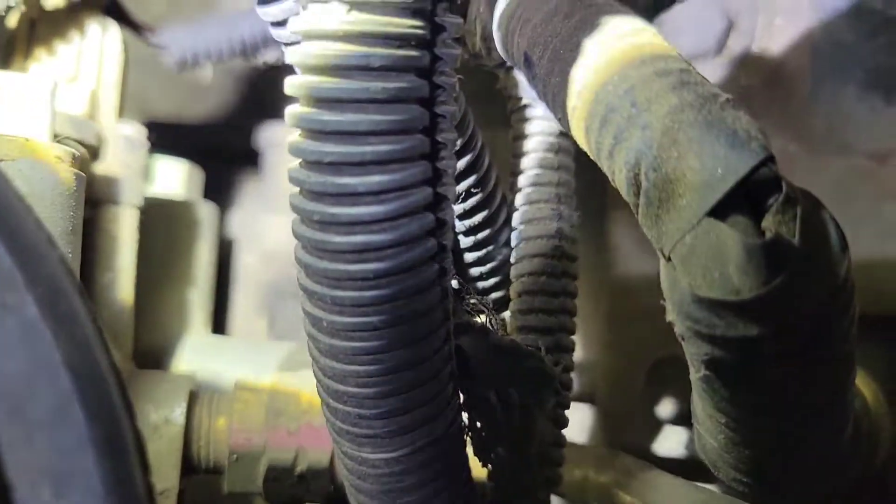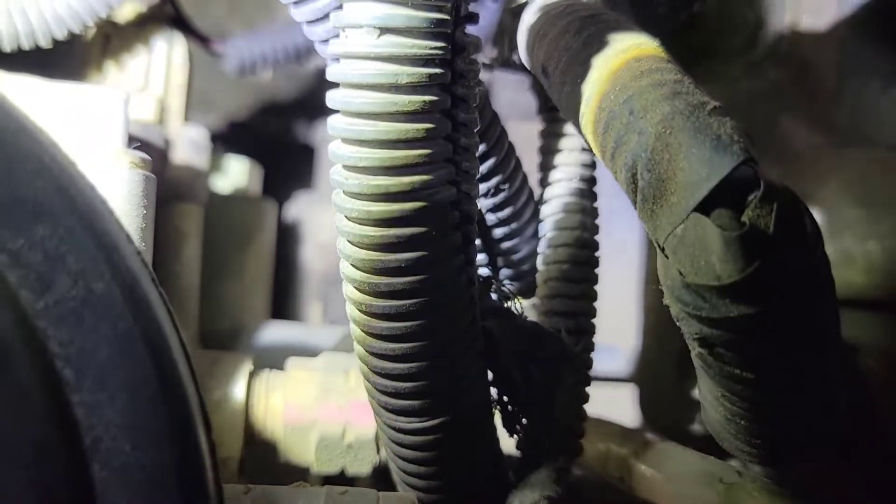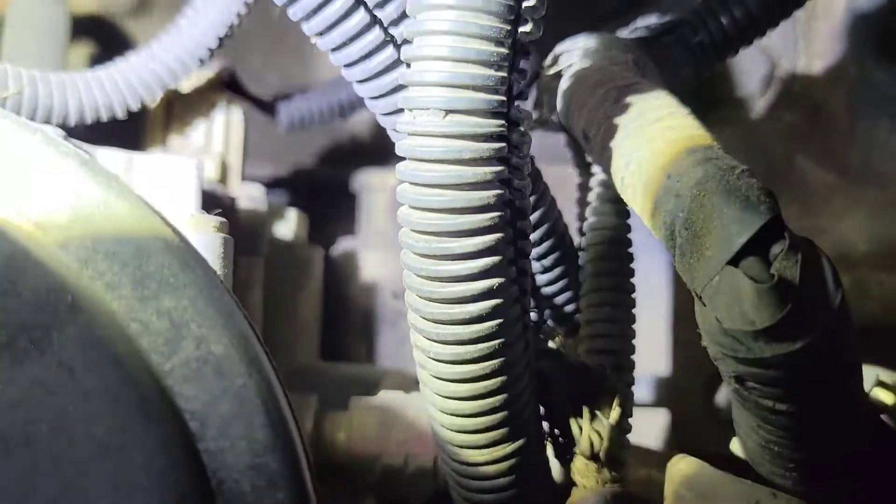Your IPR valve is right there - that shiny nut down next to the bluish wire. What you're looking for is it to be off in the valley - sometimes that nut will fall off. What I do notice is the wiring is covered in oil. I'm going to disconnect that connector and see what it looks like inside because I've got oil coming out of the connector. I'll also check the oil - this thing is about two quarts low, so I'm going to top that off.